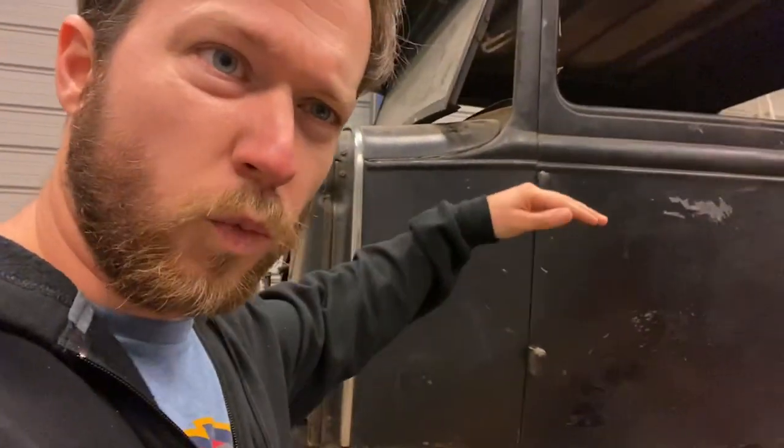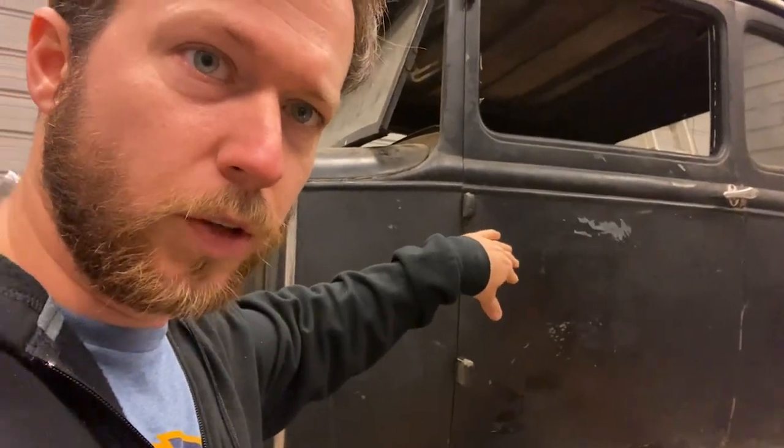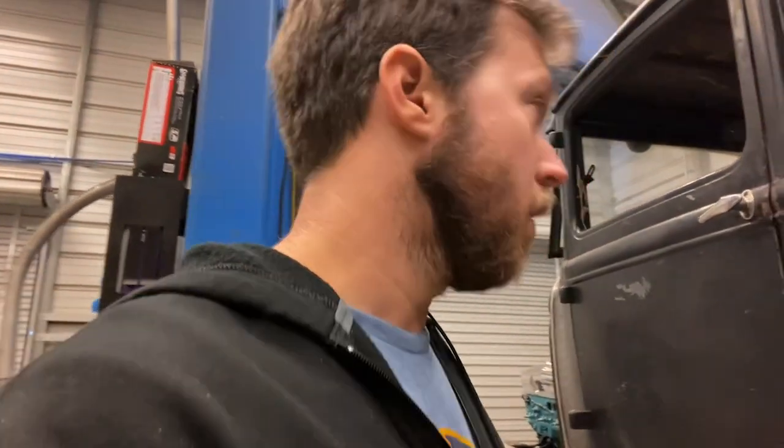Start up front. Get all your bolts in the front, because what that does is the pulling down of the cowl raises this body line, which allows the door to close good. And if you can see right now, yeah, and there we go. It closes really easy. I'm not putting any effort on it. I'm not slamming it like a pickup truck or something, but that's what gets that.